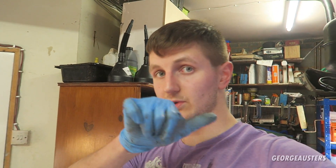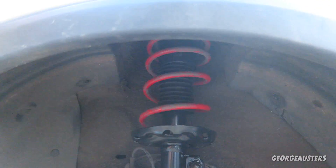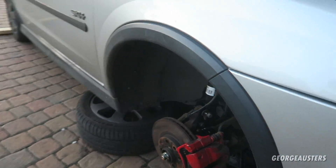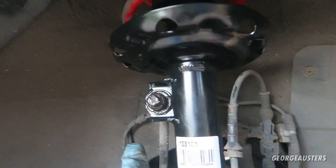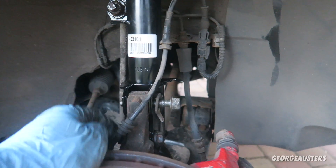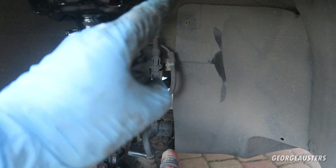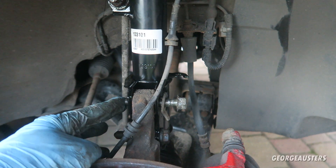I'm going to do both sides at the same time. I'll go ahead and get the strut off the other side, which is the driver's side, change that, put the new one on, and set both of them together at the same time. There is one side and there is the other side — drop link bolted on. I've left it like this because I'm going to do one side at a time with the camber adjustment, so these bolts are not torqued down.